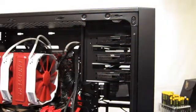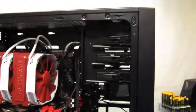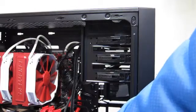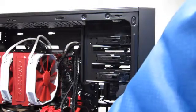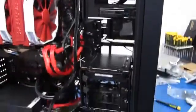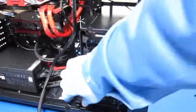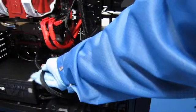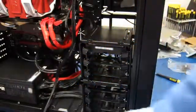One cable will go down — this end goes to the overclocker controller at the bottom of the motherboard. This cable will go into one of the SATA slots in the power supply. And then this will go into the overclocker controller at the bottom of the motherboard.